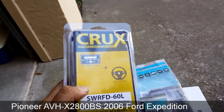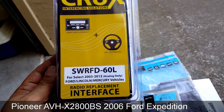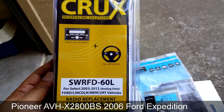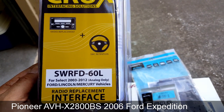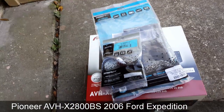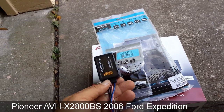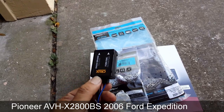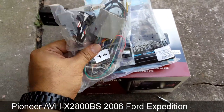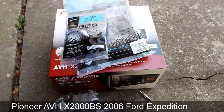You're also going to need something from Crutchfield. This is the entire harness — I'm trying to retain the steering wheel controls as well. It's specific to your vehicle, in this case the Expedition. You can look them up on Crutchfield; they have all of them. This one is the SWR-FD60L, and it comes with everything inside including the antenna cable. Here's the actual control unit that's going to control the steering wheel inputs. Pretty much everything else is in here — you'll go ahead and start splicing and putting the harnesses together to retain pretty much everything.